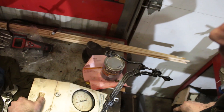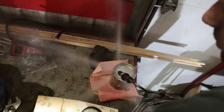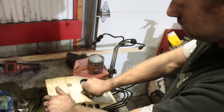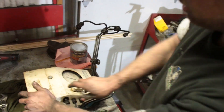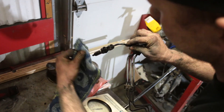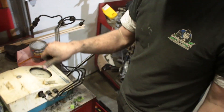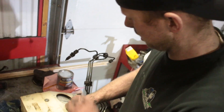Then we want to lean on the handle quickly and get a series of pops. And that looks great. Now we want to stop just shy. This tester's got a valve on it — just close the valve. As I'm closing the valve, I'm increasing the pressure on it, tighten it up, let it sit, dry it off after the spray, and make sure that there's no leaks coming out anywhere. If it's holding pressure, it means it's not leaking anywhere and we're safe to put this back into the engine.